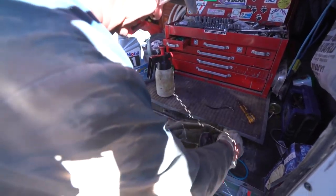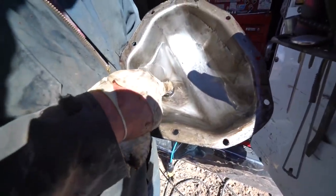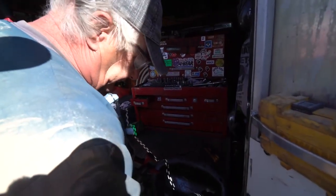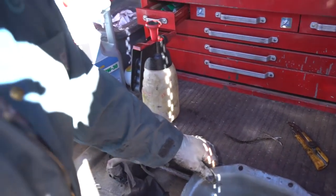It doesn't have to be spotless — it's not like a dentist's office. Here is your killer: if there are chunks on there, you've got big issues. That stuff on the magnet is just called dust — that's not a big deal. Now if you got chunks on there, you have to find where they came from, because that could be a piece of a gear or the differential breaking off. But this is just dust — nothing to worry about. That's why you've got to clean this up, because if some guy sees that somebody changed the gear oil, they'll assume it's all clean — but if you leave dirt in there, it could take the differential out.